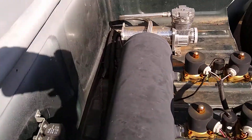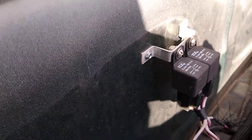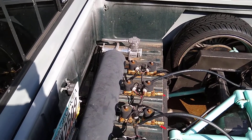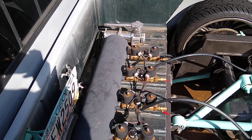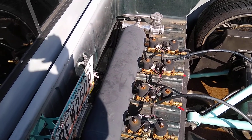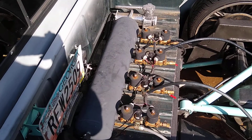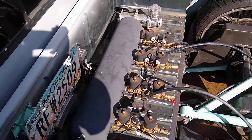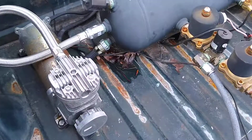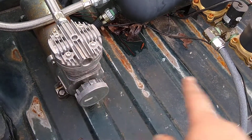Basically you have power coming from your battery, and that power comes to these relays. The relays are for the pumps. With my specific system, I have a switch in the truck so it doesn't get energized unless the truck is running, and I have to flip the switch on to have power to both the solenoids and the relays for the pumps. Your pumps come online — both of them.